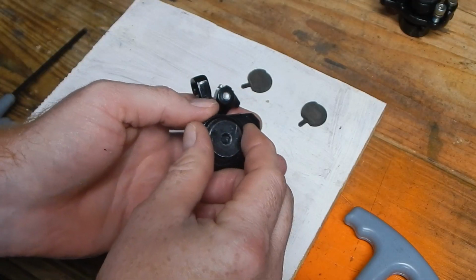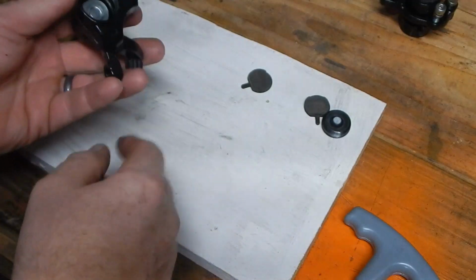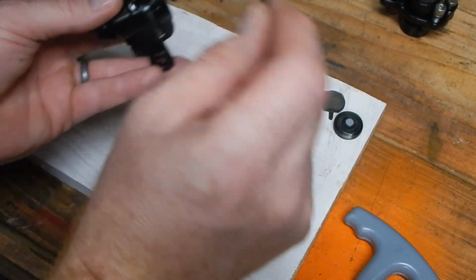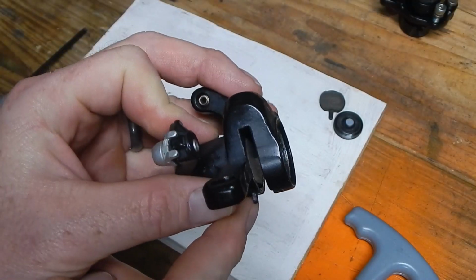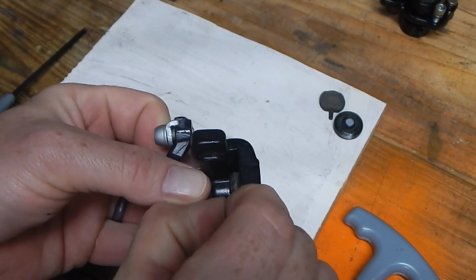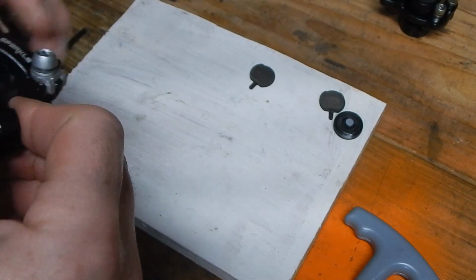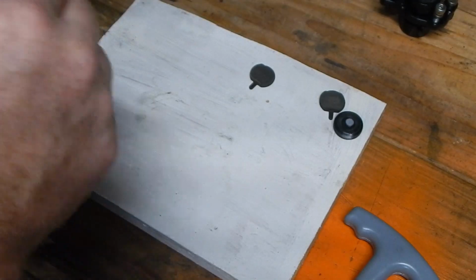You take this out, just completely unthread it all the way out, and it'll pull the pad with it most of the time, so set that aside. Pull your other pad out. It's literally just grab this little tab, because it's magnetic retention. It's just magnetically held in place. You can easily overpower that and slide up and out. You can save your old pads. If you want to go get replacements, it's easy to go to your local bike shop and just do an exchange.